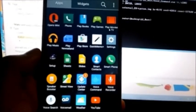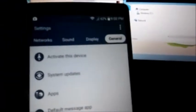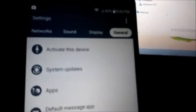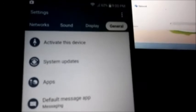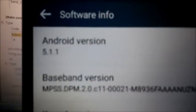It is on 5.1.1. To wrap up: follow everything to a T. Download the system.img for 5.1.1 and place it on your external SD card. Make sure the update.zip is downloaded and saved on your external SD card. You don't need the 5.0.2 system.img — you can bypass that. Make sure you have the LG root zip file unpacked to your desktop. You will need a PC for this — you cannot do it without one. Follow the forum instructions exactly to a T.